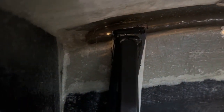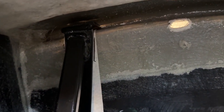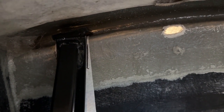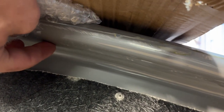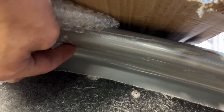I'll mark a line either side of the bracket so I know where it's going. Then I'll remove the bracket and drill a little one millimetre hole — not that it really matters because it's all going to be covered in carpet or leather on the back — but a small hole quite high up so I can see whereabouts the hole needs to be made on the other side. With the hole on the other side I'll be able to tell whereabouts I need to come up and then start opening a hole on the underside of the scuttle.